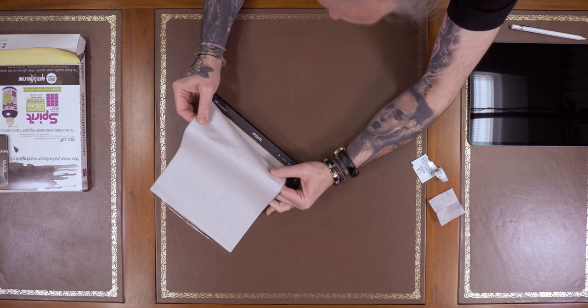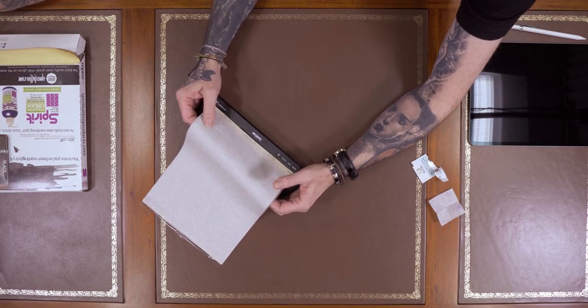So are there any tips and tricks you'd recommend? One of my favourites: you'll see people hit print on the iPad and then scramble to get the paper in — the brother jiggle. The simple trick is don't send the document to the printer until you've set the paper up. Your data light comes on because you've sent it and the moment you do that it's going to grab it and start printing. That's how you see people getting the paper in a little bit late and by the time you get there it's chewing up the corner.